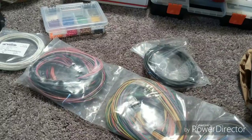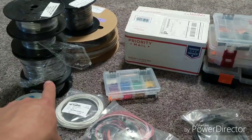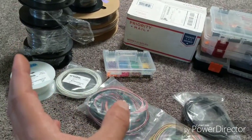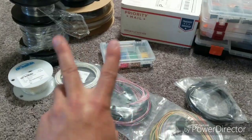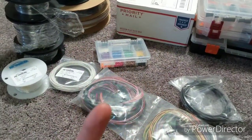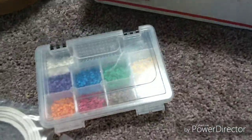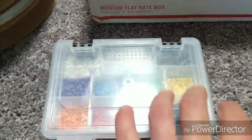For all the stuff going into the factory chassis harness, I'm using only black M22759 — that's going into two, not one, two of the ECU Master PMU-16s, which is a power distribution module. It'll have these little call-outs so I know which wire is which. That was from Joel, so thank you — respect.